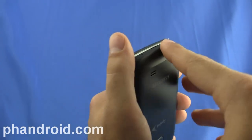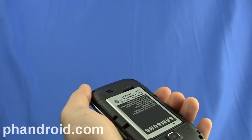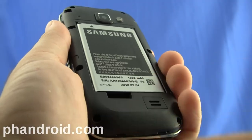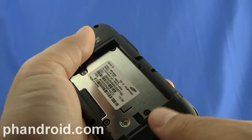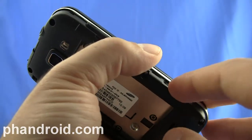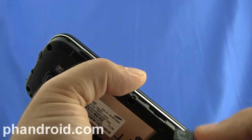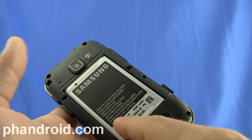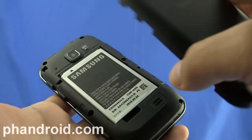The back of the phone has a little opening at the top — you can slide your finger in and pop it open to reveal a 1500 milliamp battery. Find the groove at the bottom of the battery to easily pop it out. At the bottom right of the battery, you'll see the microSD slot, which holds up to a 32 gigabyte microSD card. While you can remove the microSD card without removing the battery itself, you do have to remove the battery door.